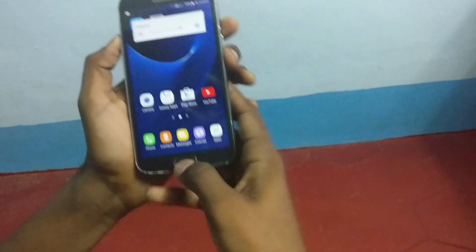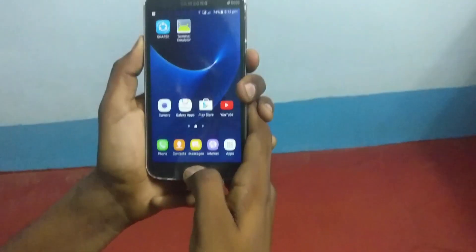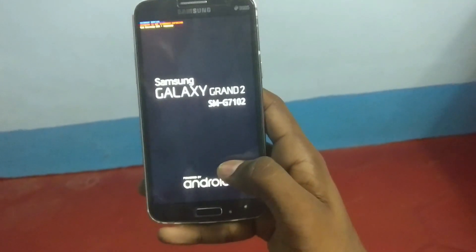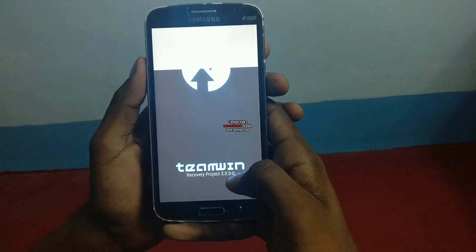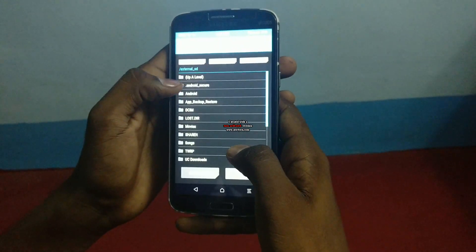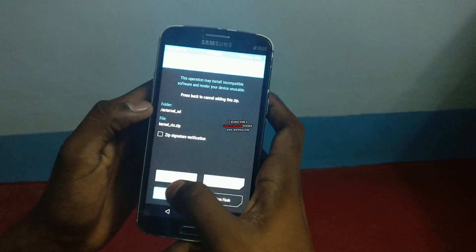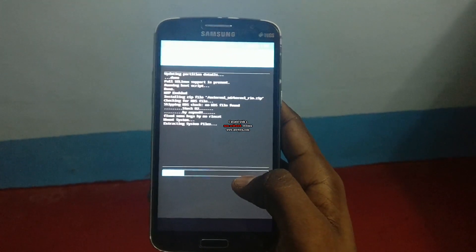So let me go to recovery first. To go to recovery, press volume up, home and power button. It is going to recovery — I have already lost my warranty. I have TWRP recovery. I told you not to flash the camera fix zip for this ROM; if you have an error in camera then you can flash it — I don't have an error so I didn't flash it. Now I am going to flash kernelrio.zip. Flashing this kernel will make you un-rooted, so you need to flash SuperSU again.